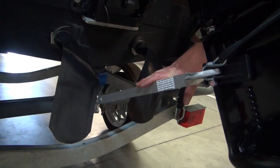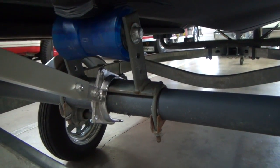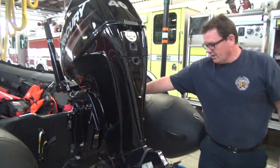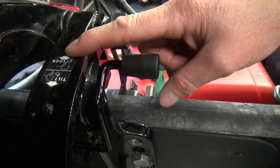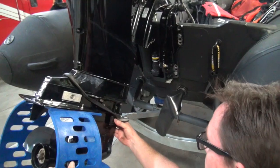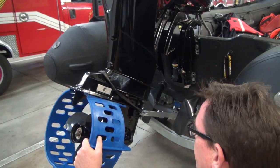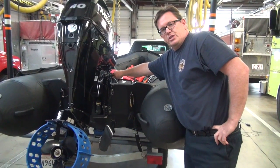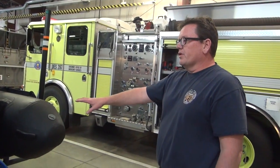Additionally on the back we've added a support for the motor. This is going to take weight off the transom while it's being trailered. On the bottom end it's a U-shaped piece of support that just slips right over the trailer. Then you need to lock the motor once it's in position — flip the lever into the lock position to keep it from bouncing. On the motor end of the trailer there's a little V of plastic material that goes just above the water inlet, and then a rubber bungee up and over with a hole on each side to help secure it. The motor should be in the locked position so the weight is down on the support — tilted down and locked so it can't bounce up.